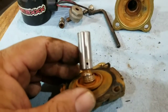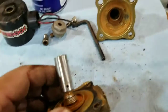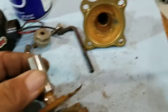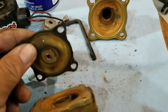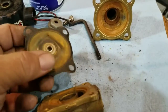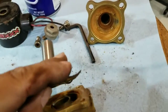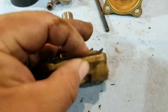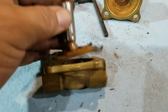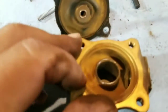That's the other problem you'll run into. Once these get beyond fixing, you're going to run out of it being able to move. Periodically, if it's like this, hopefully you can take this apart without the diaphragm ripping — because if this diaphragm rips, you're done. It's got to hold pressure right here where it goes together, and it's got to be able to have enough play to go up and down over that ring.